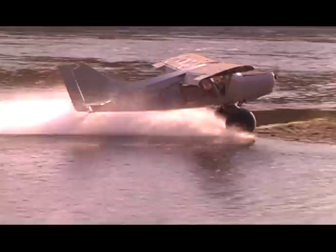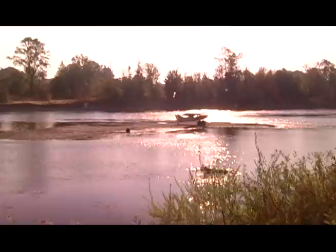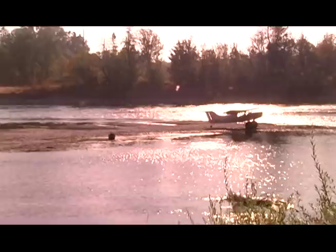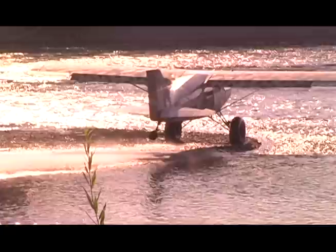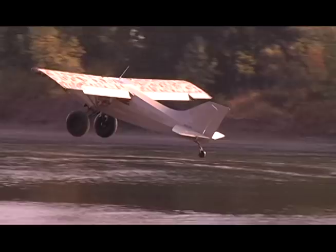This airplane originally weighed 1257 pounds when I finished it on 31-inch bush wheels. Back then I was running an 84-inch 1P235 prop pitched at 43. This propeller is a 90-inch prop pitched at 33 — it's quite a bit heavier, adding close to six pounds to the nose. But the trade-off is amazing: it took my takeoff roll from about 150 feet to 100 feet, and that was purely propeller performance.